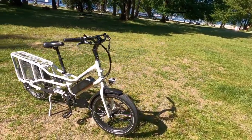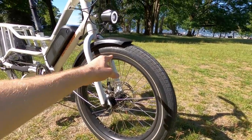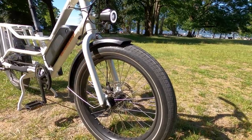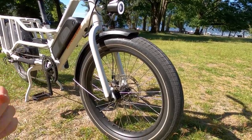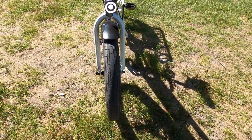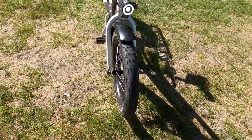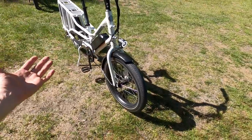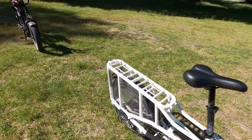The primary focus when I first heard about this bike was this new wheel size. The tires are 22 by 3 inch — that three inches is very wide. A lot of traditional bicycles will have like 2.15 or maybe even 1.75, but three inches is almost like a fat tire. What that gives you is stability and comfort, because there's higher air volume. It gives you a lower attack angle, which is more comfortable. But they probably didn't want to go too tall, because then mounting the bike and loading it with cargo becomes more difficult.